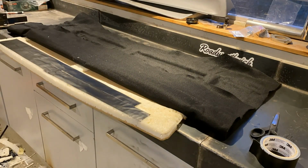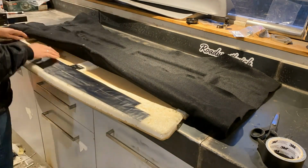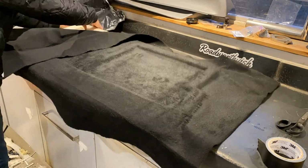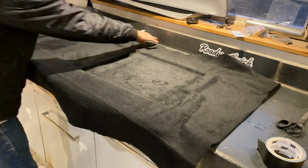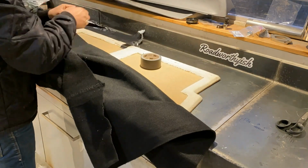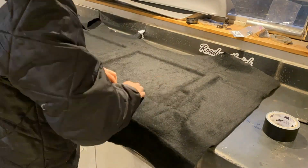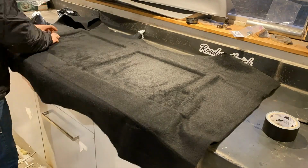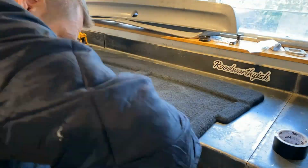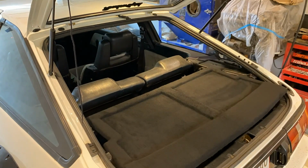When you're all set, you hit it with some spray adhesive, some sort of glue that'll hold it together. This is a contact cement that I'm using. So apply on both surfaces and let it set for a bit until it gets tacky, and then just put it together and make sure to get the cloth all the way into the corners, and it'll stick and hold itself. All right, trimming the edges, just leaving about 5 millimeters again, as you can always trim it more.